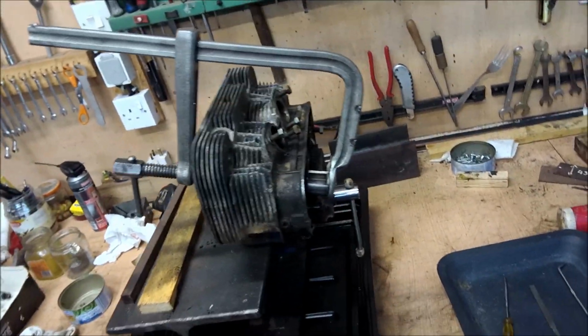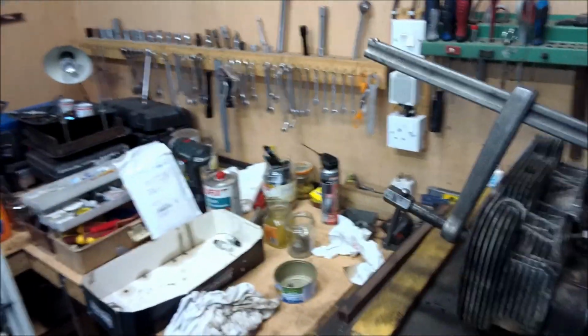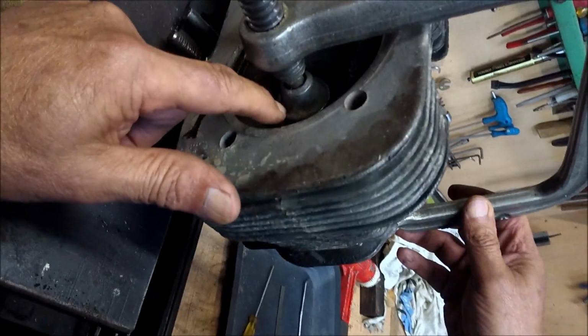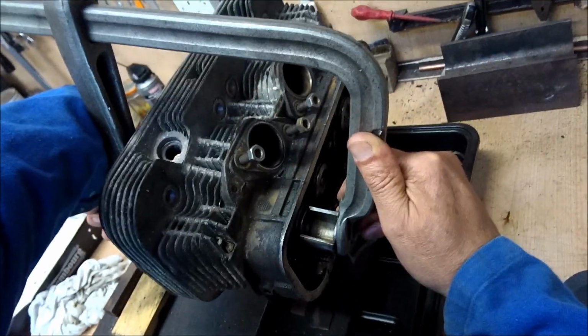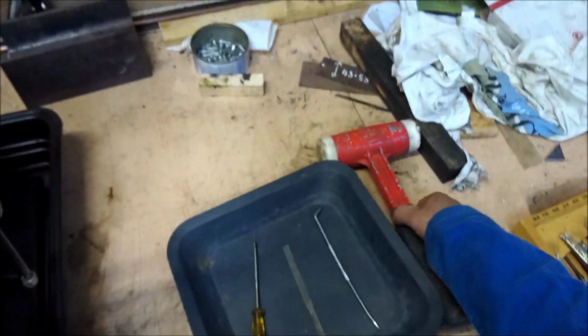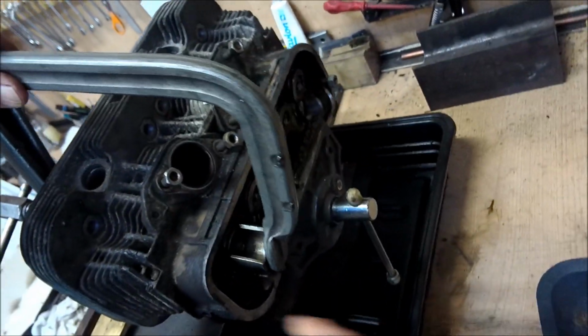Right, valve spring removal. There are all sorts of super duper valve spring tools. This is what I've been using for over 40 years. Right, little stainless steel collar, big welding clamp. The foot sits on the valve, and so on. Now, we put it under a bit of tension, like that. Soft mallet, and we go bing, like that. That has now released the little collets.